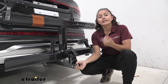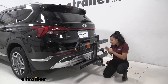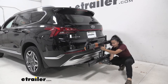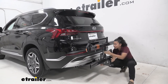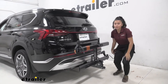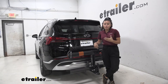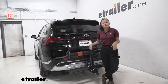This is also a tool-free install — you tighten it down with a knob right over here that extends a ball cam on the inside of your shank. For the anti-rattle test, as I shake our bike rack I'm nearly shaking the vehicle, really showing how secure the fit is between our shank and our hitch receiver. This makes for a smoother ride for your bikes overall. They'll still wobble a bit over bumps and dips in the road, but you don't get extra rattle from an improper fit.